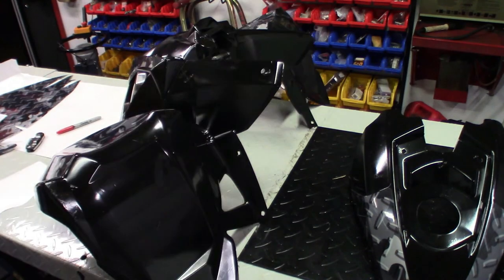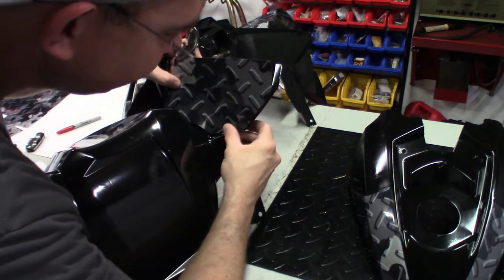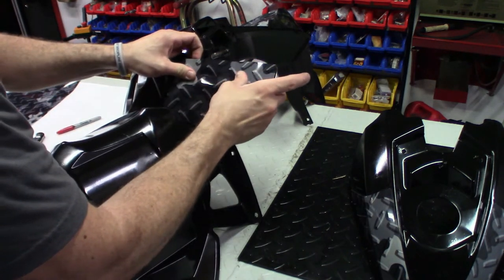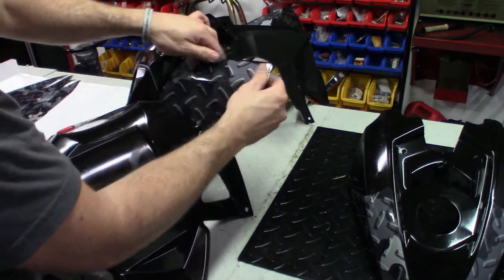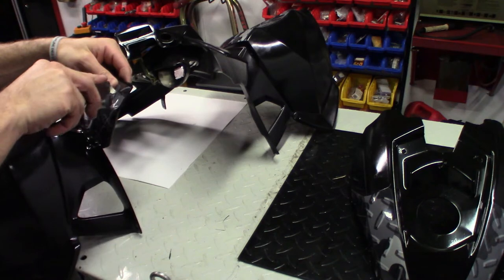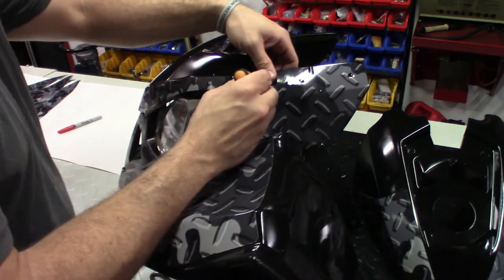This front fairing was actually cracked a little bit on the top — I think I zip-tied the crack. This piece was fairly flat and easy to lay. Don't forget that you've got to come back and cut the fairing mount holes out so you can get your screws back in to put this back on the ATV. Lay from the bottom and work it up toward the top, getting all the air out. Apply a lot of pressure. I used the razor knife to cut where the hole should be for the screw, and then used a poker tool to poke the hole out.